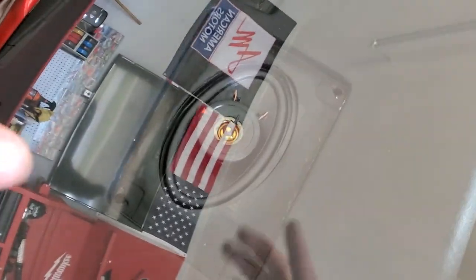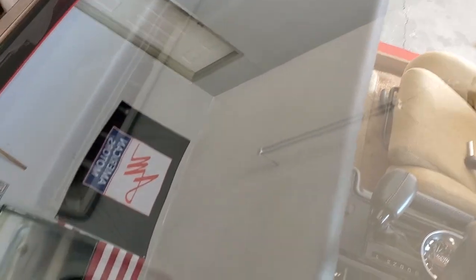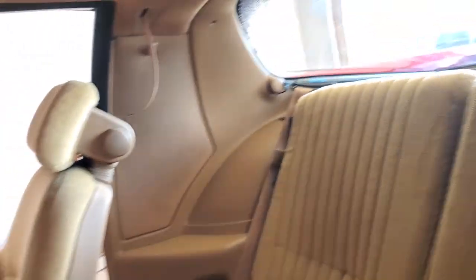Alright, dash is back in, speakers are in — you can see them here. I took the grills off and I'll explain that later. Still gotta put the screws in but wanted to make sure everything works before doing that. Onto the backs — this is literally just a cardboard cover with some carpeting felt on it. There's our rear, I believe a 6x9. You can fit just about anything back here but I want something that matches the front. Looks like 7 mil screws — I said 8 mil earlier but it's 7 mils, all four.